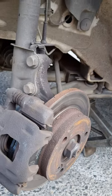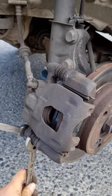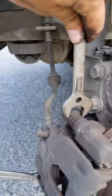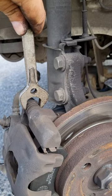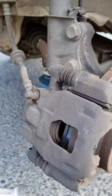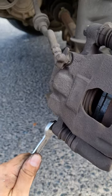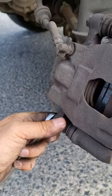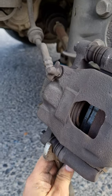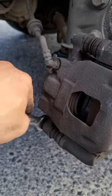Your 12 spanner here and your 19 spanner here, and then you lock that up. The 19 goes here on this part just to hold it so that you can tighten the 12. You see that part is turning, so you're going to need the 19 spanner to hold the back part, and then tighten with the 12. Same goes for the other side — simple job, done.